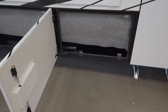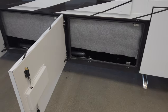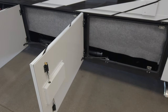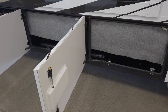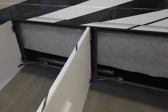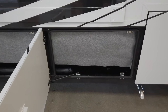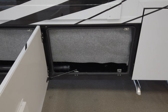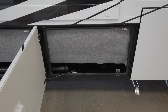I really like this feature on the Renegades — you've got a 75-gallon black tank and a 75-gallon gray tank, and they are enclosed inside of the coach. They are heated, but just wind chill factor — the fact that they're inside the coach means they're protected from debris that would kick up from the road, like gator treads from semi trucks or rocks. For people who like to ski and want to use the coach in cold weather, it's a lot easier to keep those tanks from freezing when they're in a closed environment without wind blowing across them.